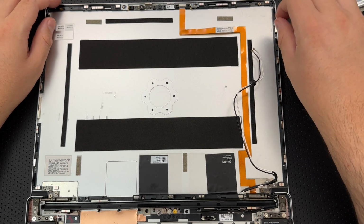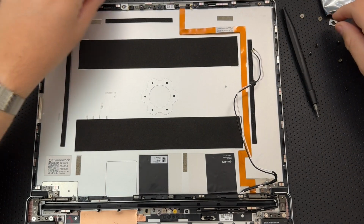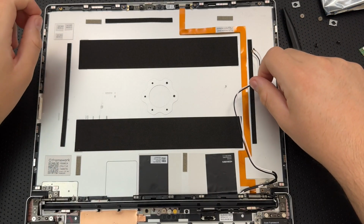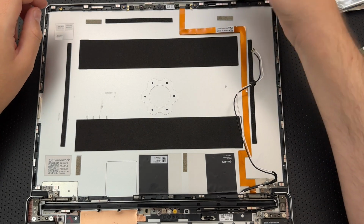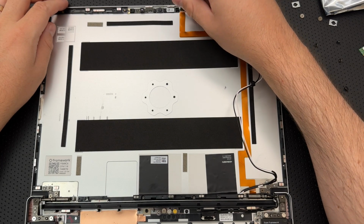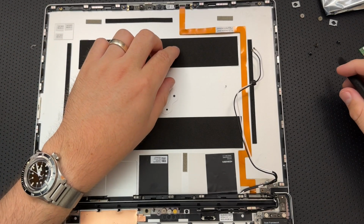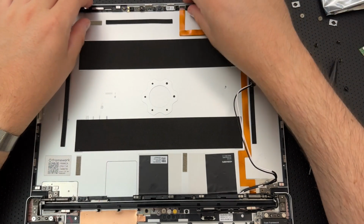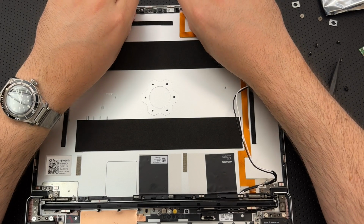Okay, remove the magnetic washers under the screws. I assume that's this here and this here. Beautiful. Flip up the latch on the webcam cable. Oh, this bad boy right here. Okay, so that has one of these latchy dudes. So I lift that up. And now I should be able to remove the webcam module. Okay, so that's this whole situation.